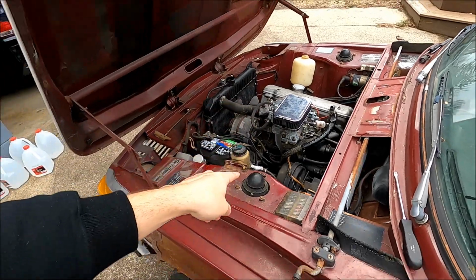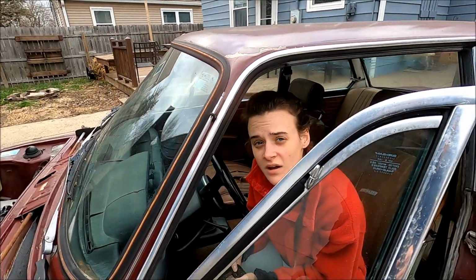So after thinking for a minute, I think what we're gonna do is worry about the coolant first, get it filled up and topped off and bled, and make sure it's not gonna overheat while keeping it running with the pedal. And then after we get it warmed up and the coolant bled, then we'll mess with the idle screws once the car's warm, and then we'll mess with cold start the next time it cycles, because I think you're supposed to tune the idle when it's warm and then mess with idle speed and cold start choke stuff after that. Sound good? Sounds good. So let's fire up.